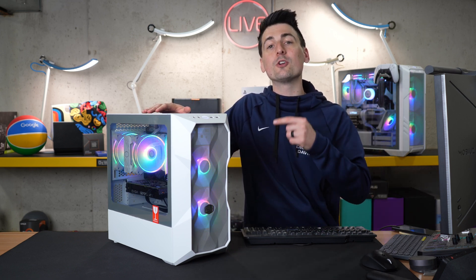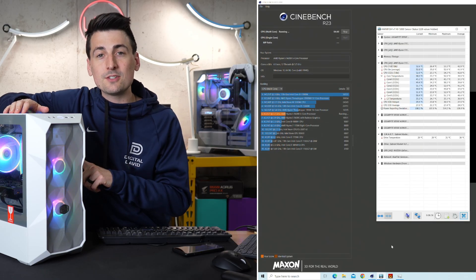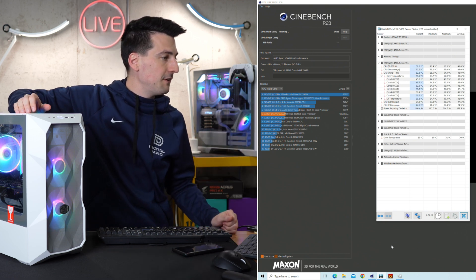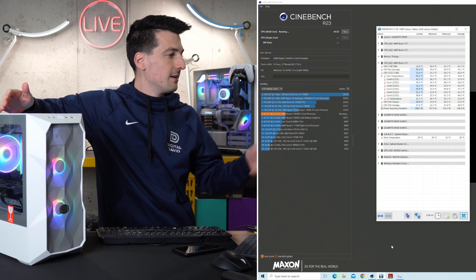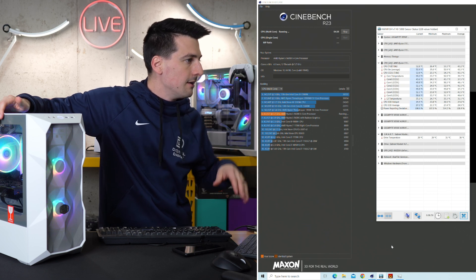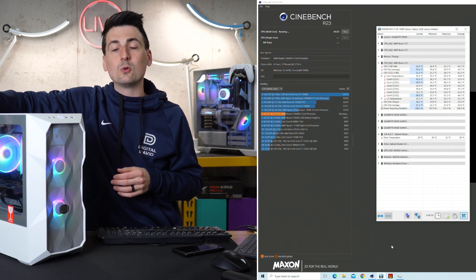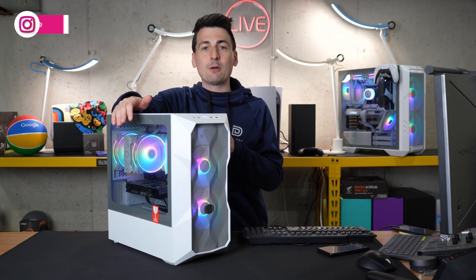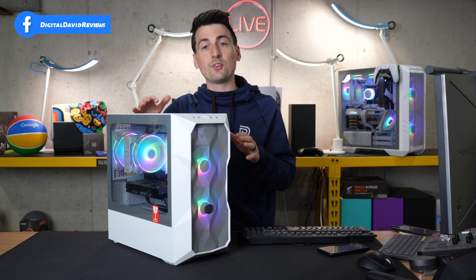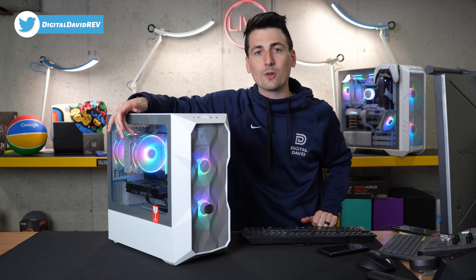Now let's put that CPU under a full load, really stress it out and see how warm it gets. The CPU is currently being stressed to 100% using Cinebench R23. It's been running for a couple of minutes and we've peaked at 53.3 degrees Celsius. The maximum overall is 54.3 degrees Celsius across all readouts — basically anywhere between 50 to 53 degrees Celsius under a full load with this cooler and CPU combination. So it's great that we have plenty of headroom if you want to use a more powerful CPU. A lot of variables depending on your build and how everything else is configured, but you should expect very similar results. It's more than a capable cooler.